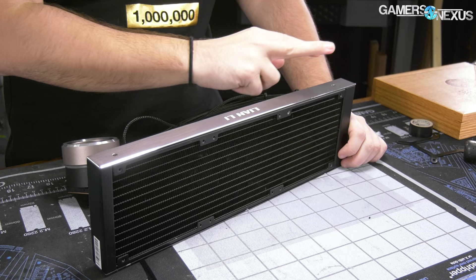There are a ton of Torx 9 screws up here. Taking all these out will open up the rest of the chamber. These screws are differing lengths - the longer ones line up with and go down into the bottom part of the chamber. Very annoyed that Lian Li put those unusual screws in there. These coolers are normally pretty easy to maintain with age - you might need to add more liquid if permeation gets bad, and you could even replace the pump fairly easily if the parts are accessible. You'll need to buy that bit though.